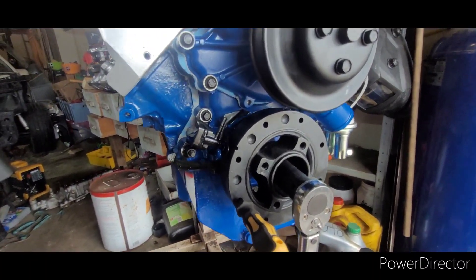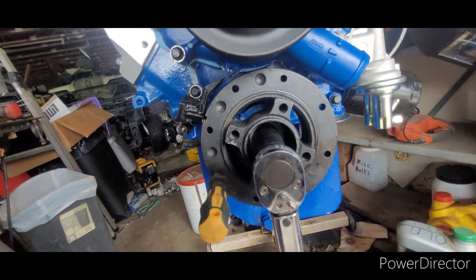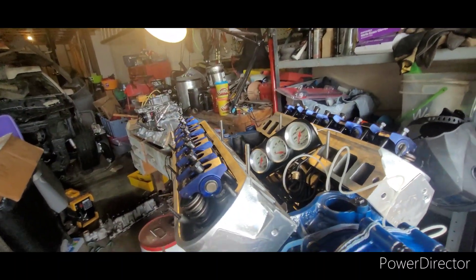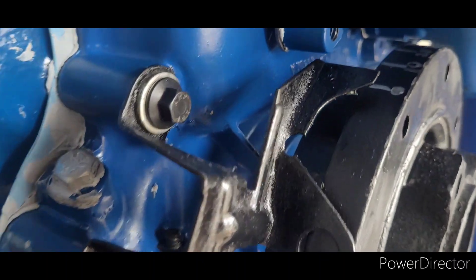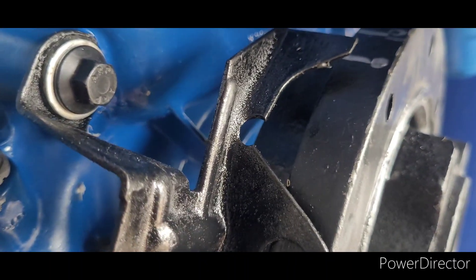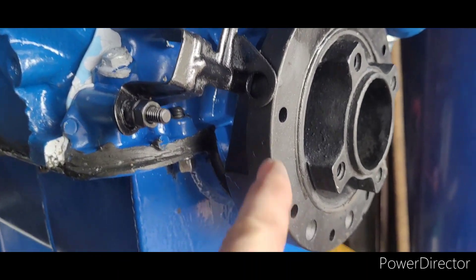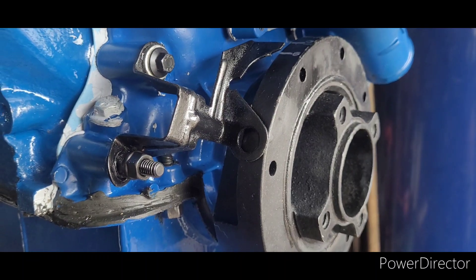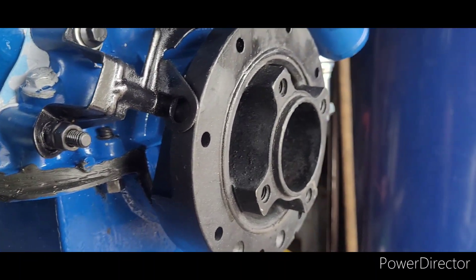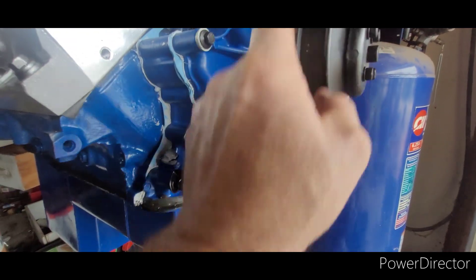Here's the next day — as soon as we had oil pressure last night we called it quits. It had been a long day. Now I've got to install the harmonic balancer and the intake and that's pretty much it. I drew in the harmonic balancer as far as it'll go, torqued it down. The pointer is in the middle of the balancer, doesn't look terrible. I just realized today that I don't have a balancer pulley, so not exactly sure what I'm going to do about that.